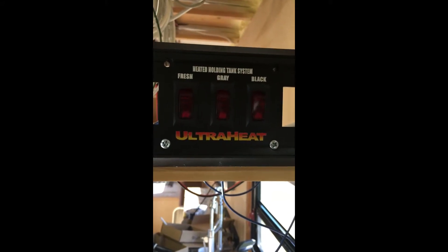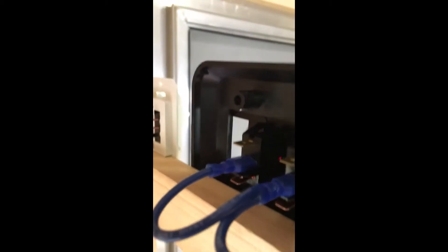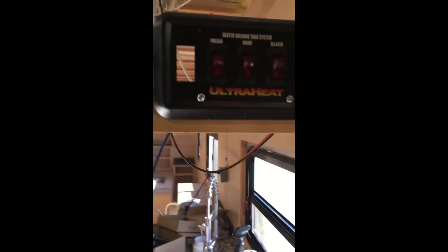I've got my holding tank heater panel temporarily mounted. I didn't have any 16-gauge red wire, so I'm using a piece of 16-gauge blue wire to temporarily hook it up. I created a jumper situation to provide power to all three switches for testing purposes, and then I'll hook that into my circuit panel. Instead of a 5-amp fuse, I'll use a 15-amp fuse to cover the load for all three. Just want to test them out and make sure the wires are working.